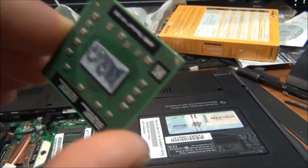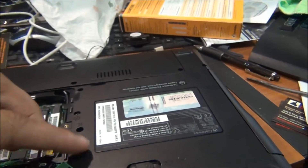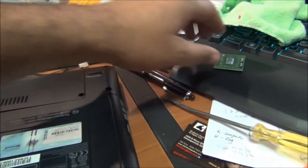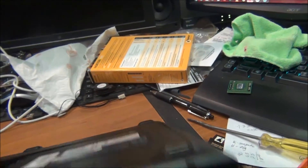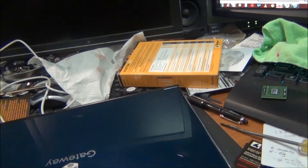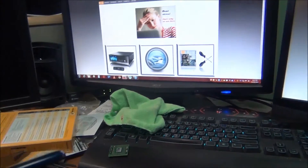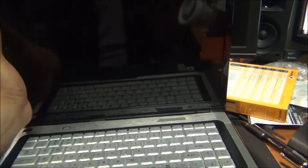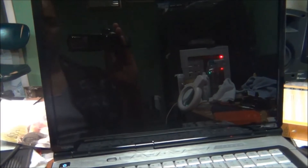If my theory is correct, it was a bad processor. Here's the old one, which had no thermal paste on it originally. I did apply some thermal paste to it and tried it out, and it still didn't power on — so I'm thinking it just went completely bad. Here's the replacement processor, probably just a little slower, and I'm going to attempt to power it on and see if it works. Hopefully this helps someone out if I'm correct — let's see, let's hope it does.